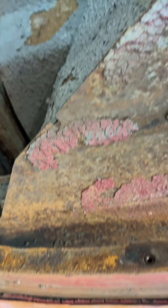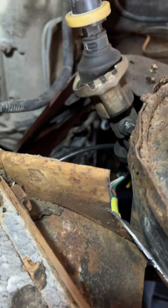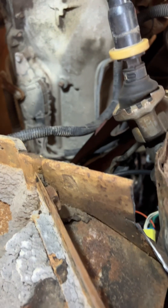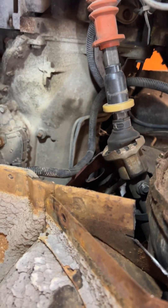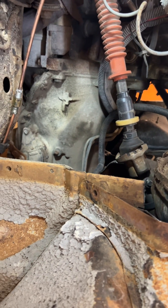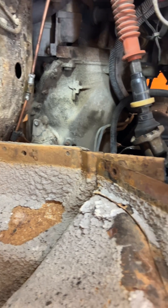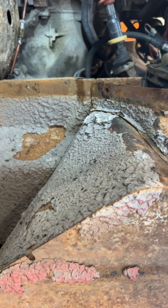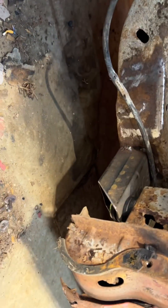Finish those up because I don't think that's enough weld to hold the cab on. E-brake cable — gotta punch it through the firewall right here. Gotta go find my pedal for it and the brake booster. I'll have to pull the booster and clean it — that'll come off when I pull the cab, so no big deal. Steering coupler — I have a better one for it so it won't be thumpy anymore. Fix that angle, it isn't much but it makes a tight spot in the steering, so I've got a U-joint for that. There's also a little hole in the firewall to patch once the cab is loose.